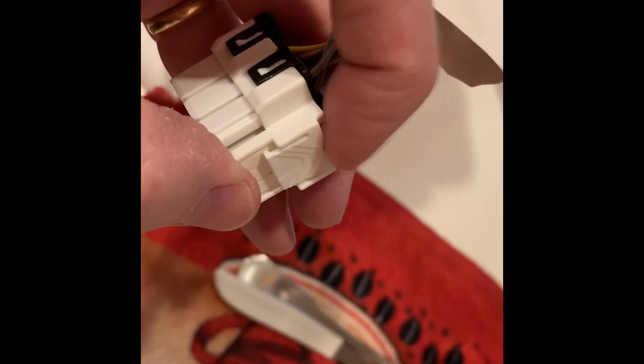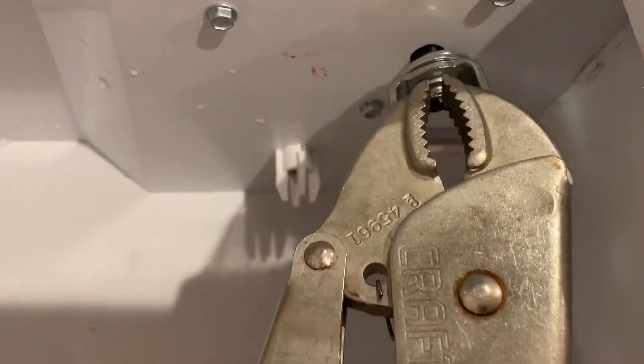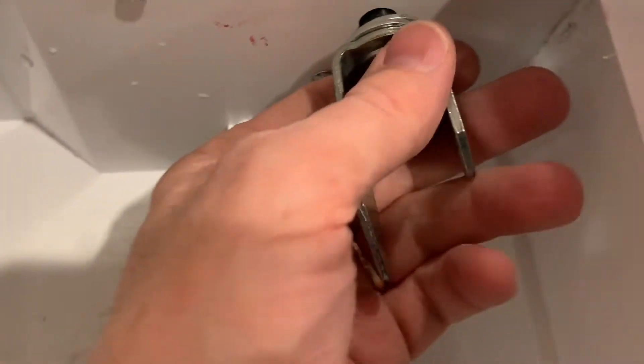Just use a screwdriver in the shaft. What I had to do was take a pair of pliers and lock it on, twisting clockwise to try and loosen it, because it's a left-hand thread, while pulling out the same way. I finally got some purchase and was able to twist it enough, and then I used the pliers and a screwdriver. Luckily the motor really didn't move much, so I was able to twist it all the way out.